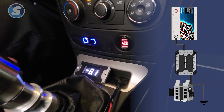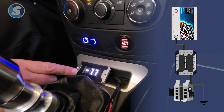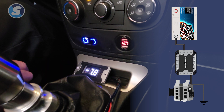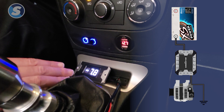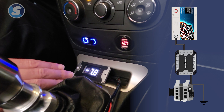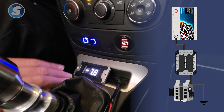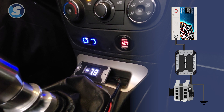If we have a stereo system or a battery that needs charging, we're going to see this flip positive. It's important to know that alternators don't put out their full current at all times — just because you have a 300-amp alternator does not mean it's going to always do 300 amps. It depends on the draw. If you put a fresh battery in or just took it off the charger, we will not see much current draw at all. When we first start the vehicle, we'll see a spike to charge up the batteries, and as the batteries charge, that number should drop until they're fully topped off and it should be close to zero. This is great for seeing how your alternator performs with different heat conditions and being run down from the batteries. Every alternator is going to act differently, and voltage alone won't tell me that story — but real-time current draw will.